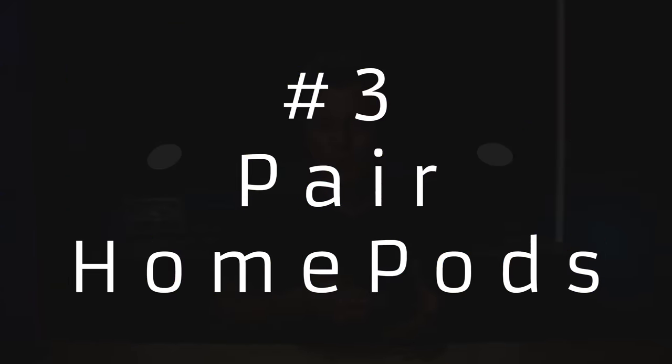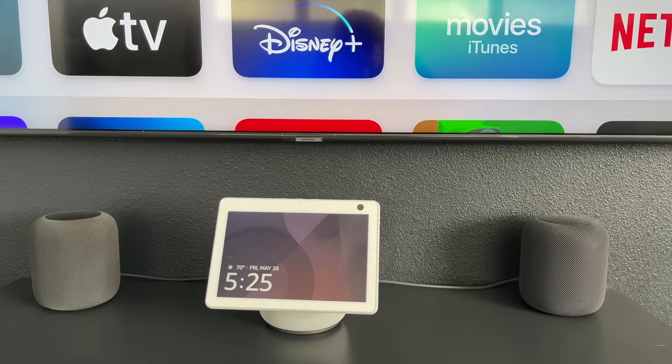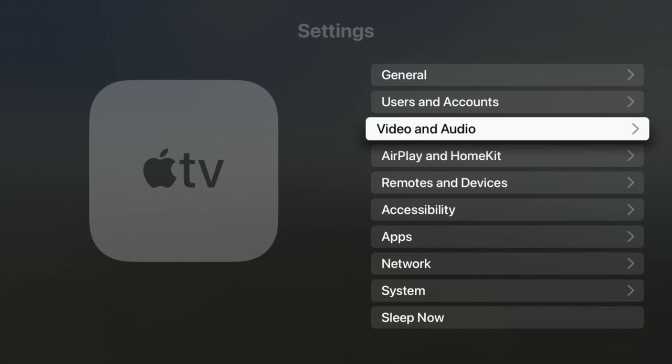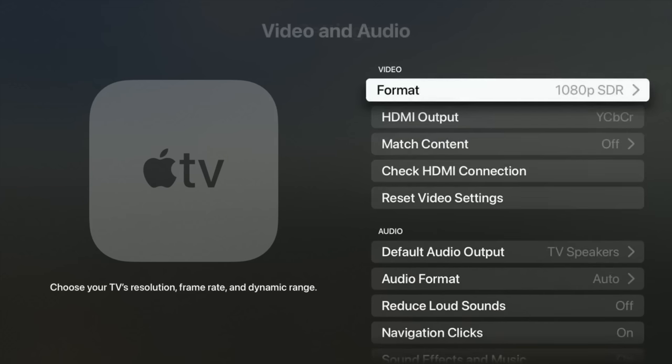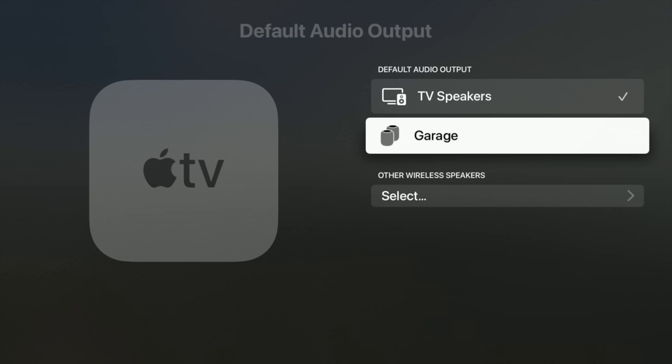You can use a single or a pair of HomePods or HomePod Minis as speakers for your TV. Once paired, you could get stereo sound out of two HomePod Minis, or you could get Dolby Atmos out of a full-size HomePod. To access this, go under Settings, then Audio, and pick your default audio output. The way it knows what it can be paired with is based on the room assigned to each device — since my stereo pair of HomePods are in the garage and I've made this Apple TV a garage device, it sees the two and will connect.